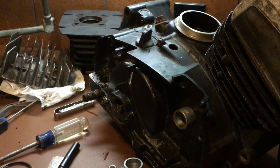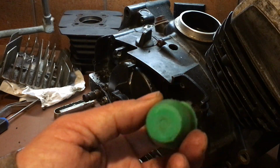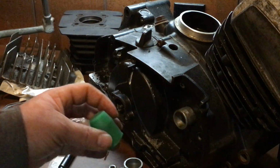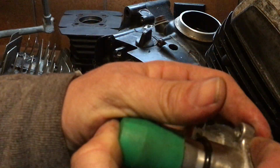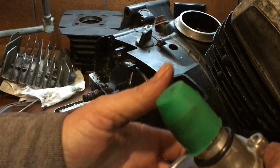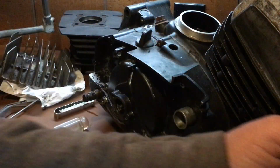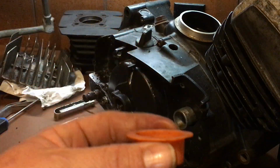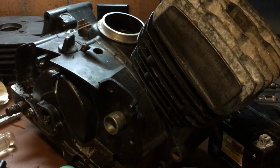Okay. Now, what I do is I seal off a couple of things. I have some caps. These you could get anywhere. They're just caps. Find something that fits in your house, that fits over it. I put this on here on the intake, like so, and I'll put a hose clamp on it. And I'll take another one like this, right here, and I'll put that in the exhaust. Okay, and then I'll tighten down the flange without the exhaust system on it.